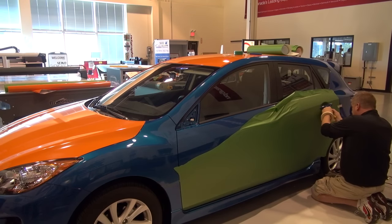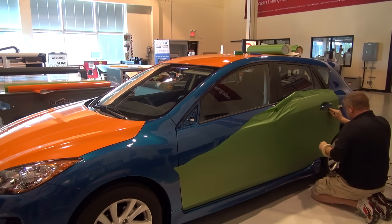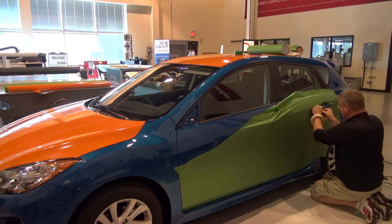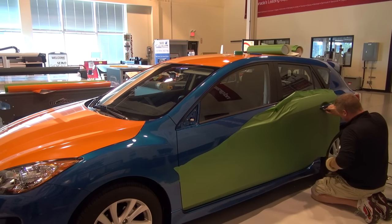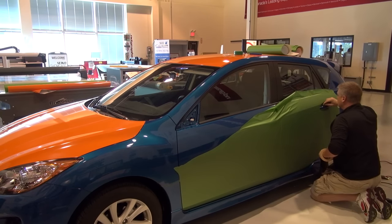Also knives. A lot of people ask, what knife do you use? I used to use a Richards or an Olfa stainless. I really like that knife, but I found that I had to push a little bit more with that because it's a lighter knife. And so we've switched over to the Olfa XA1. It's still a very good knife, but the weight of this is a little bit heavier, just slightly, and it allows us not to actually push. We just score lightly. The weight of that knife does all the scoring for us, and we never really have the tendency to cut paint.